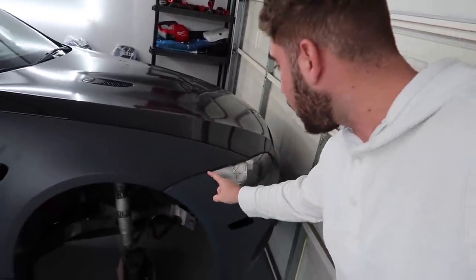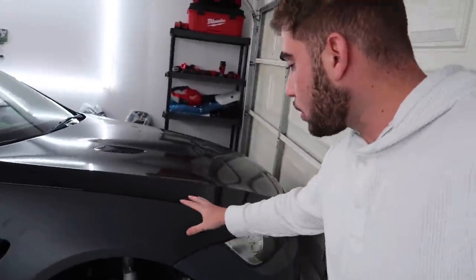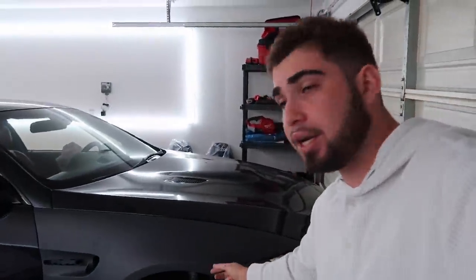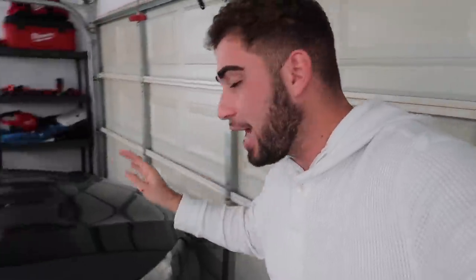Believe it or not, I didn't mention in the last video — there are two zip ties on this side. The reason being is when you buy the fender from BMW, you don't actually get the bracket that's on the fender. I got the bracket for the bumper off the original bumper, but obviously the bracket that was on my fender was completely destroyed. So I need to find the part number for that. I honestly cannot find it anywhere. If any of you guys can help me get that part number — the part that goes right over here where the bumper attaches to the fender — it's basically a little bracket piece so you can put in two screws.